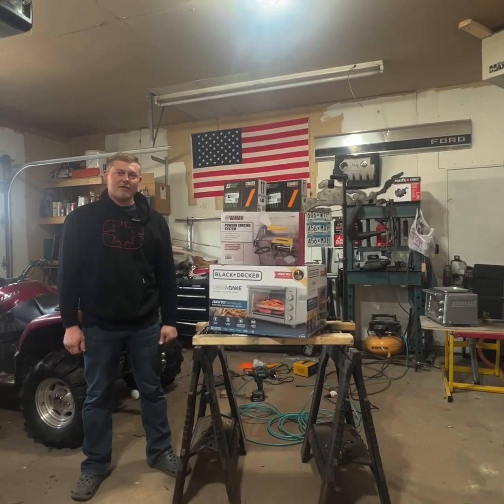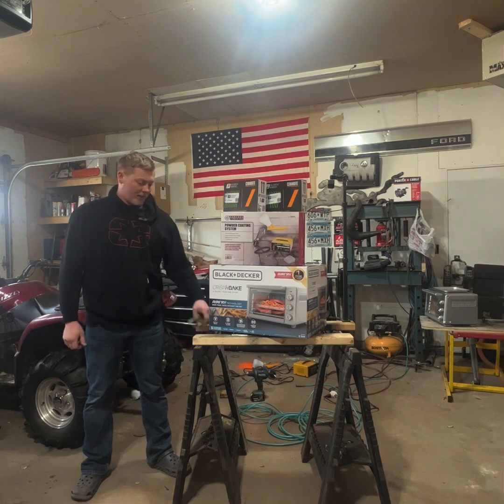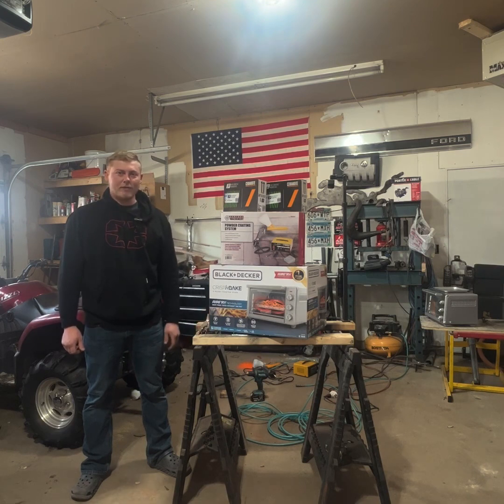Today we're going to be continuing on our blaster rebuild project. To start off with, I'll do a short time-lapse video just putting the blaster engine back together. The last video we ran into some problems. The clutch was bad, we needed a new clutch push rod, and I also needed a flywheel holdback tool to torque down all the nuts. I got my new flywheel holdback tool. That worked really well. Definitely nice having the right tool for the job.